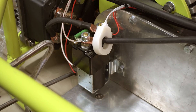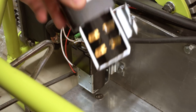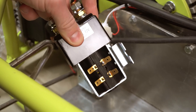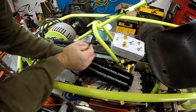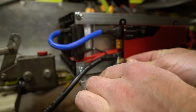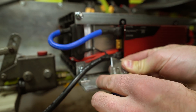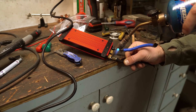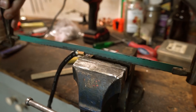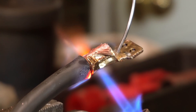After I got the batteries fastened into place, I swapped out the original 48 volt contactor with a 72 volt one and also removed the old junction box which I no longer needed. It was a little tricky connecting the number four welding cable to the BMS — I decided to reuse the lug that came on the BMS. To do that I first had to detach it using a torch setup, then cut out the original cable and crimped and soldered the lug onto the welding cable.